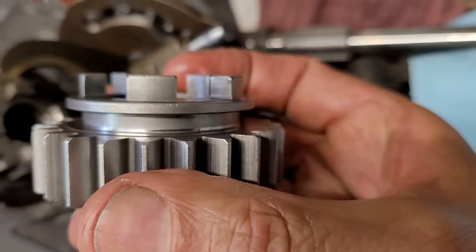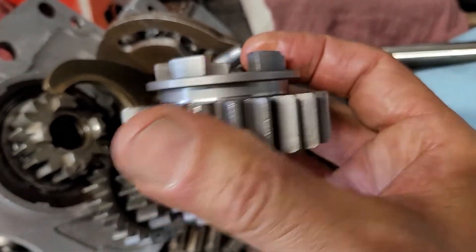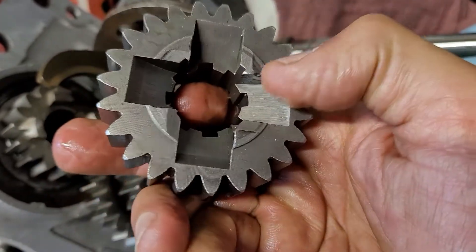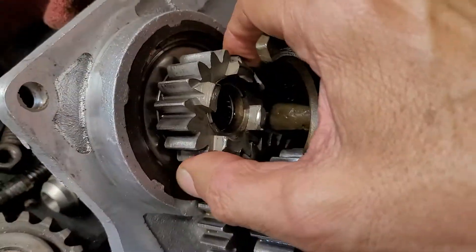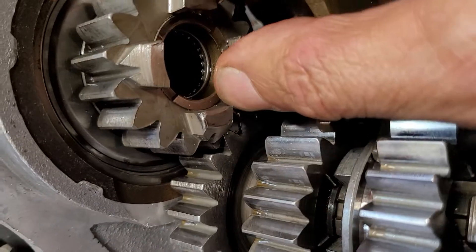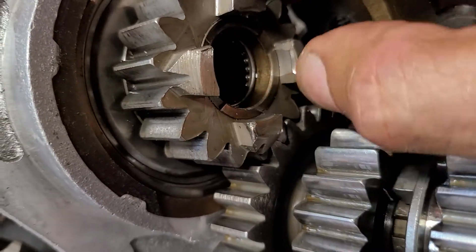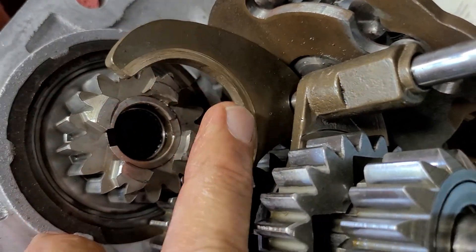We'd expect this side to also be kind of burned up, and they are. You can see that slight taper on them — that's what kind of holds them in gear, that's the undercutting. Again, hammered right here. This is the main shaft gear — hammered, look at that, it's horrible, really rounded and beat.